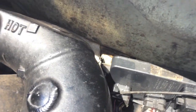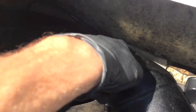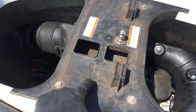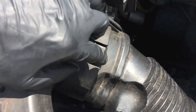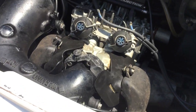To get to the part it's going to be a little tricky. We are going to need to remove this air intake portion — this plastic that feeds from here down below into the rear — so we can start removing this little cover here. I'm also going to remove this plastic top piece. On the opposite side, as you can see, there are four 10mm bolts. Go ahead and ratchet those out. Down here at the intake connection point, just pull that tab. Be careful because it is plastic — you do not want to break it. The top part is now out and I took the whole entire hose out.